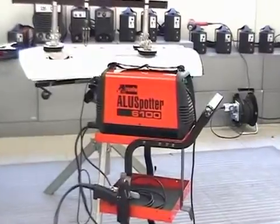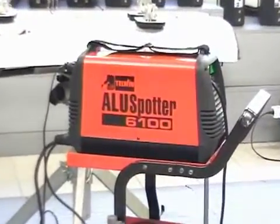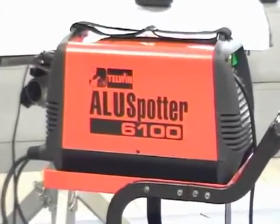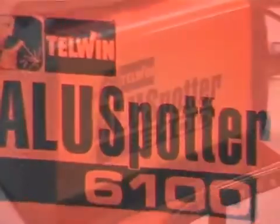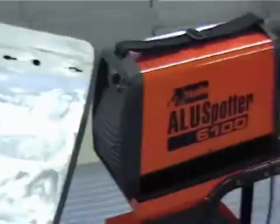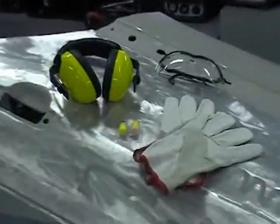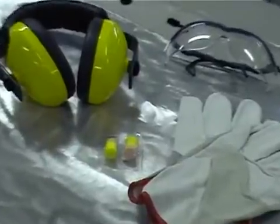Use Precautions: Follow manufacturer's instructions to protect vehicle electronic parts. Disconnect the battery negative pole, remove and protect electronic components and cables in the working area. Use proper personal safety means like gloves, protective glasses, etc., as advised in the instruction manual.